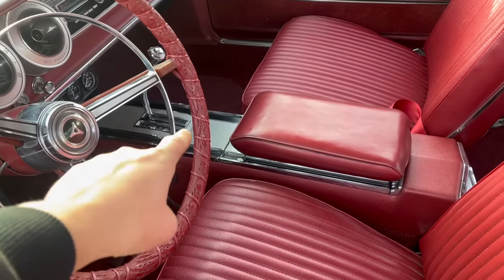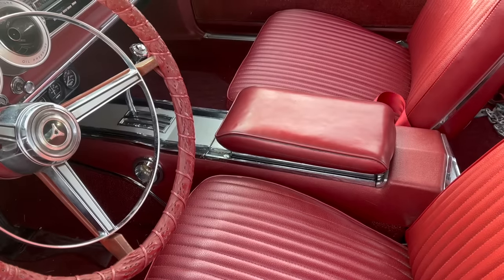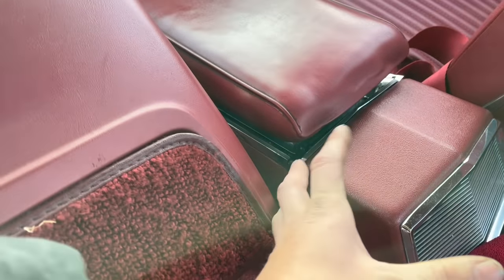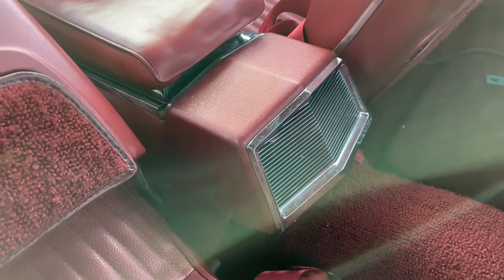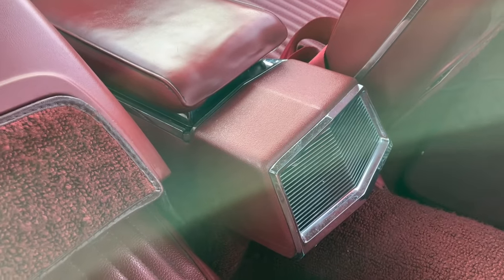There are special top plates for the 66 Charger — kind of a brushed aluminum texture. The Charger also uses this armrest which was not found in other models. On some of these shorter center consoles there's actually a seam where this piece was bolted on — that seam is where the rear section of the 66 Charger console would have been attached. There's also this fancy trim piece on this one, and it isn't even cracked, which is really surprising. They are normally broken.